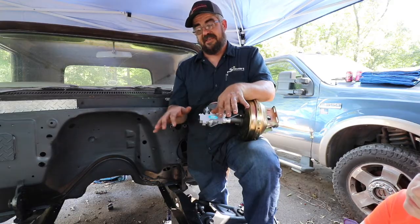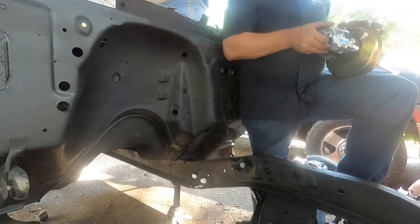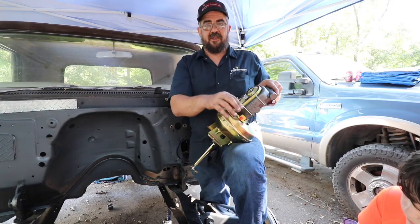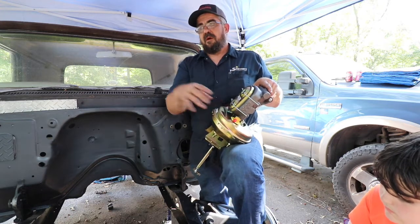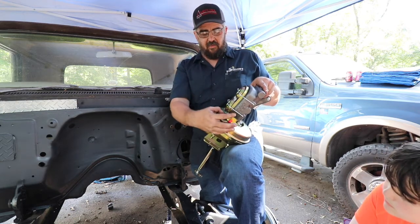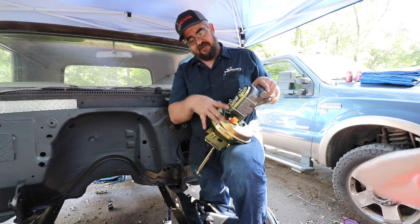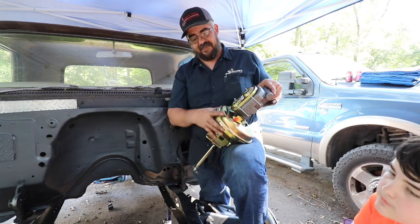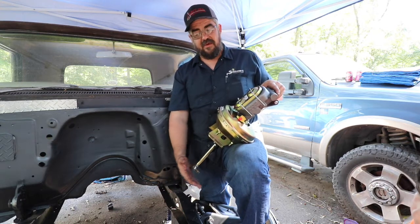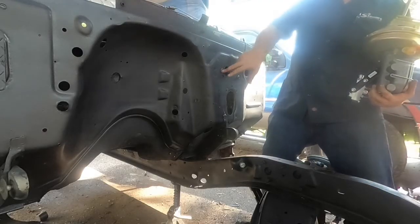Where that increases safety is if you get a leak in the front brakes, you're still gonna have some rear brakes — it's like two totally separate braking systems. This big round thing is a vacuum booster. It has a port on it — just a big piece of vacuum line that runs over and pulls manifold vacuum either off a port in the intake or at the base of the carburetor. It's always pulling vacuum, and when you put your foot on the pedal it's vacuum-assisted, making it significantly easier to stop the vehicle — adding to the safety of the vehicle.